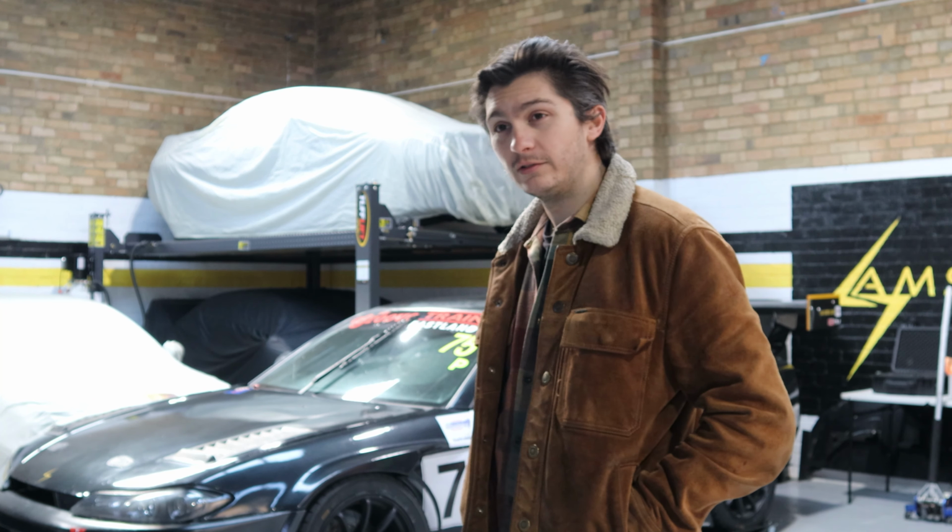Number one will be redo the rear half of the exhaust, try and see if we can get the thing to shut up a little bit more. Got to take the power steering rack out, sprung a little leak, but it's also the original one that's been in the car since 2000. So it's done all right. I'm gonna try a little bit of wiring and new trigger sensors just as the ECU is picking up some cam trigger and sync errors.